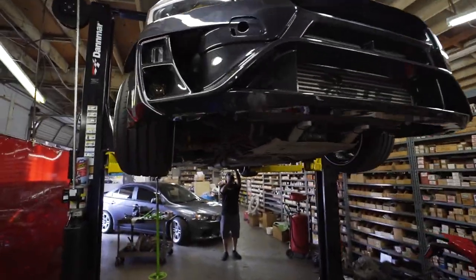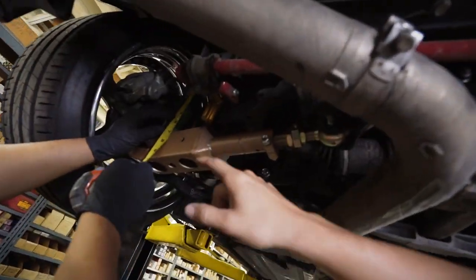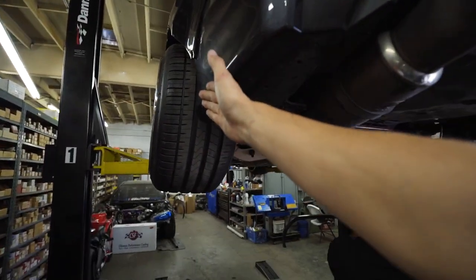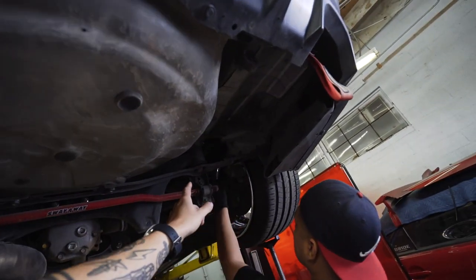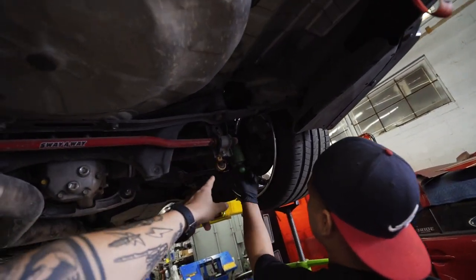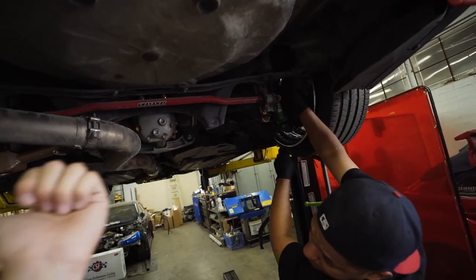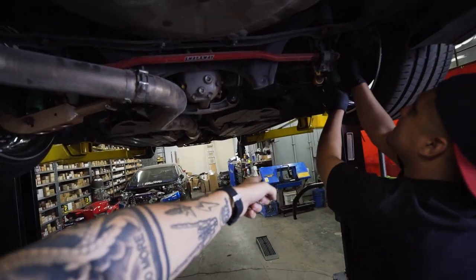We can make it super aggressive, which I always go with on my cars. If you didn't see the last vlog, we went ahead and did the lower control arms as well as the toe arms to get a ton of camber to fit these wheels in the rear. We decided last night to finish up this side - right now we're setting the height, then we'll put on the lower control arm and mess with the camber and toe a little bit. Once we drop it I can drive it to the alignment shop. I'm not going to film this - go watch the last video - but I'll update you guys when we start working on the front lip.